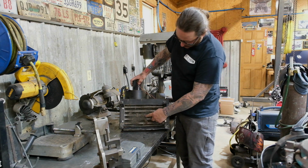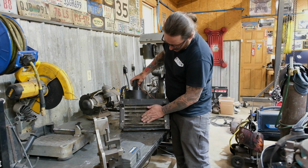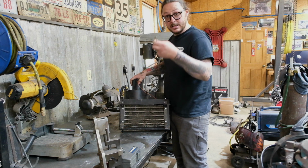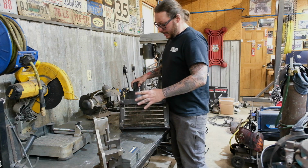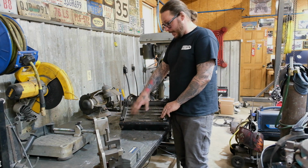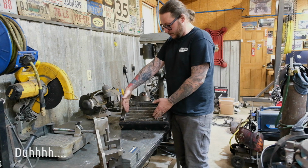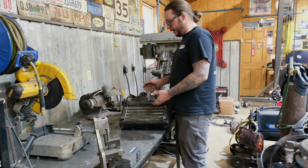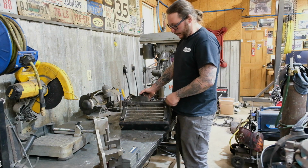Now, I'm assuming you can see the amount of debris that is stuck to the back of this guy. If you're using this type of AC in your Scout, it's a super good idea to go ahead and clean that off, because you're losing a huge chunk of efficiency of the evaporator core itself, just for the simple fact that it can't pull air across it.